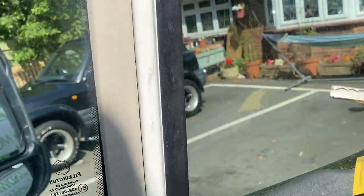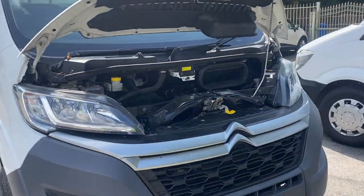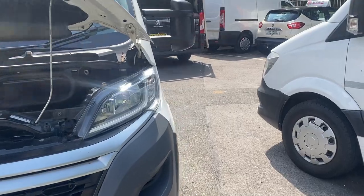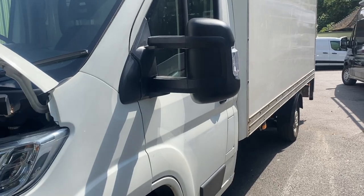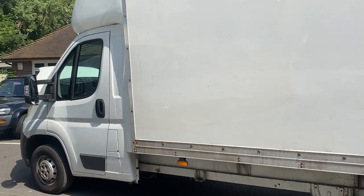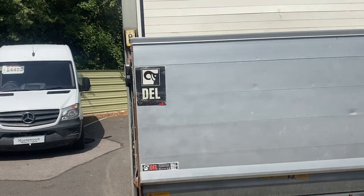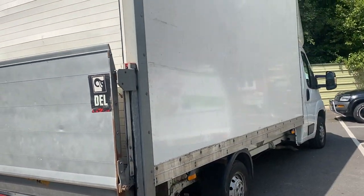In summary, the main things to check on these vehicles are: turbo condition, injector smoothness, and gearbox for crunches or whines. Look through the full service history — make sure it tells a good story with lots of maintenance receipts — and most importantly, check the HPI report. Avoid buying any vehicle with failures on the HPI check. Thanks for watching, and hit subscribe for more vehicle reviews.